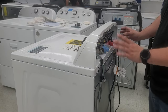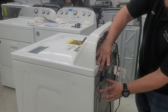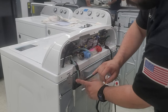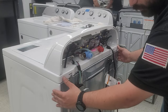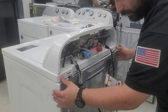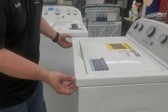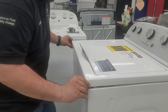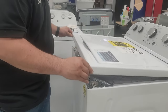On some of these machines, the key thing is to remove the rear panel, remove this locking bracket here that blocks you from being able to pull the unit back, remove this screw and this screw which hold the lid in place. The easiest way to do it is to push from the back first till it goes to its first position, put your fingers under the lid, thumbs go up till it stops you, and while holding it up push back and the machine will pop off.